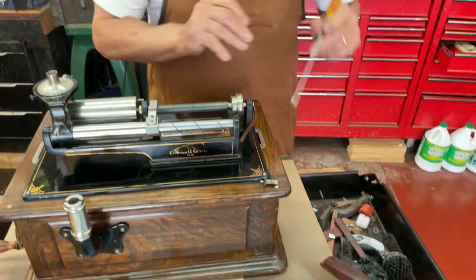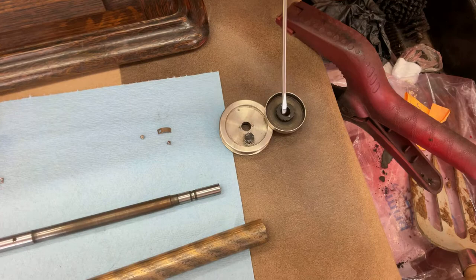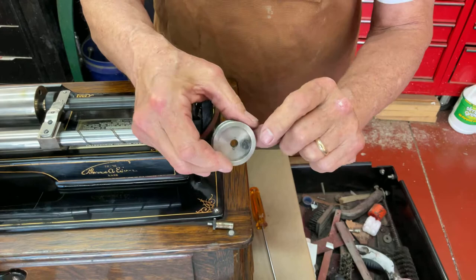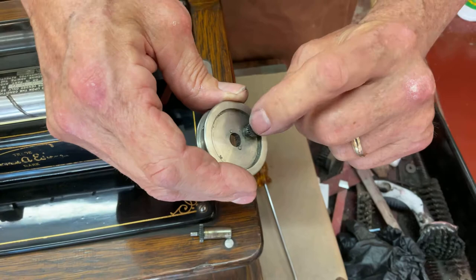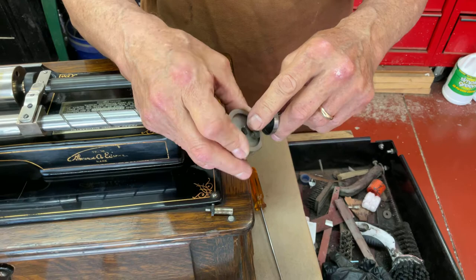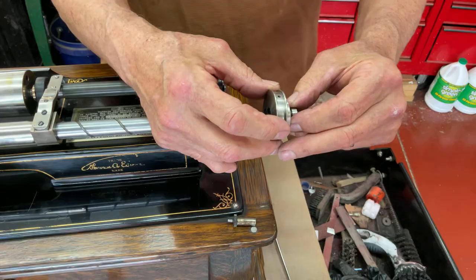The other thing on the 2-4 minute changer is you have this little pin here, a pin here, and that shiny pin there — you can see on camera that one's worn out. What those do is you have this little gear, and there's an oil hole on it right there. You want to make sure you can oil this. You can take a punch and punch this brass gear out — it all pulls apart, clean it, and then press it back on in place, because this gear runs on that gear. So when you're getting in two-minute, the gear catches and drives it into four-minute.